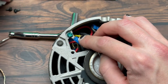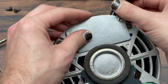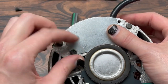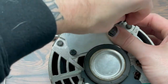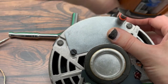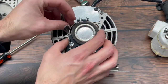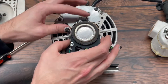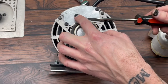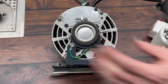Once that's done you can add the plate back. You can see your power cord — you can fit it in either one of these grooves, it doesn't really matter where. Get those bolts back in place and secure them down with the driver. You also need to put this clip back on — guide that in place and use your flathead screwdriver. Make sure that's nice and snug.